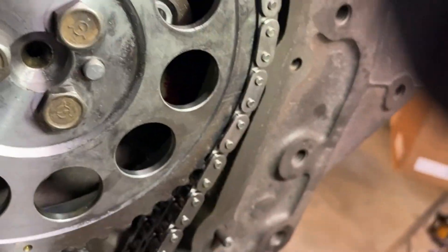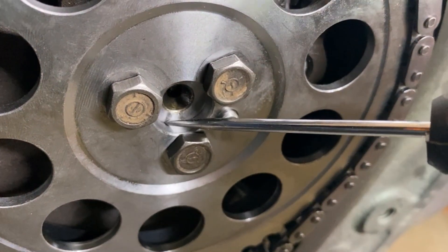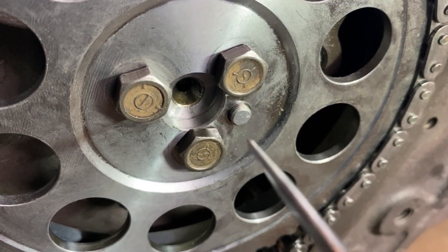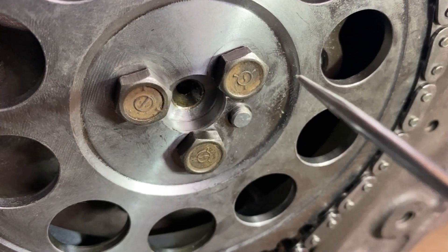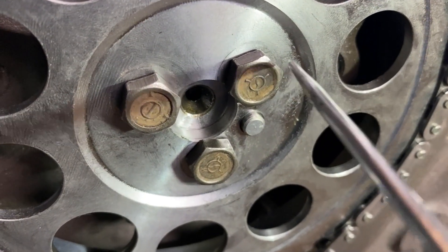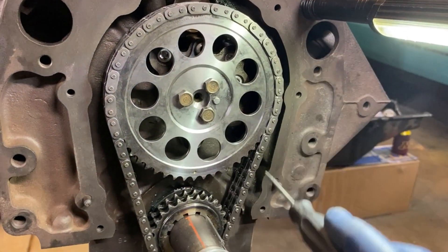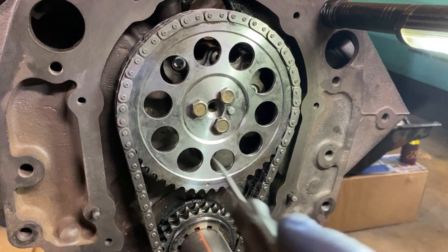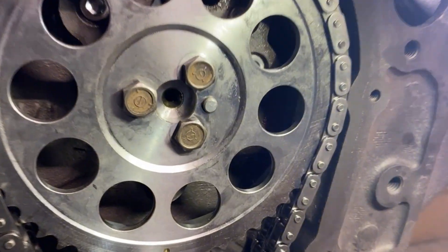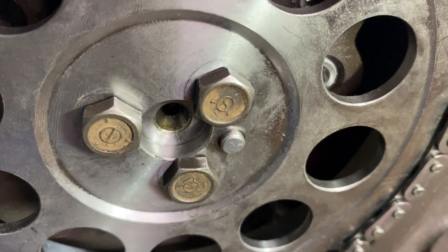The last thing to point out is I had a lot of trouble getting this top gear to seat properly. This gear is exactly right up against the camshaft - there's no clearance or space there. Initially when I put the gear on I couldn't get it to seat fully; there was a few thousandths gap because the chain was too tight for this gear to go up as far as it needed to, and that Torrington bearing that rides behind this wasn't quite seated back against the block. So what I had to do is take a heat gun and heat this chain up, go all the way around a bunch of times until the chain got nice and hot. Then it stretched just a few thousandths, this gear moved up ever so slightly, and then it kind of snapped into place. Now you can see there's no clearance - it's pressed right up against this. The bolts threaded in nice and smooth without forcing anything, and that's what you want.